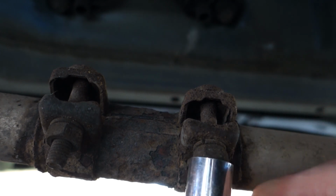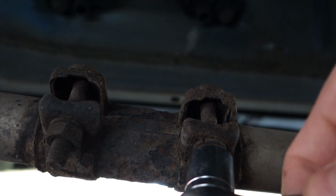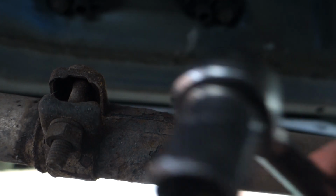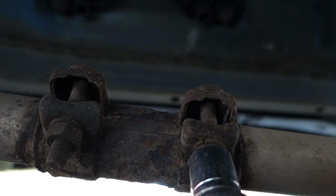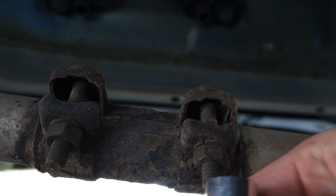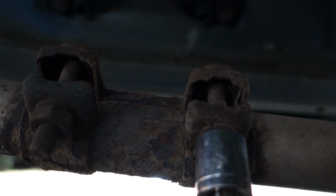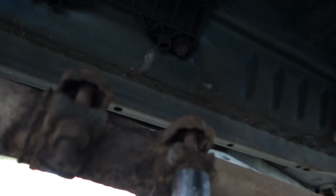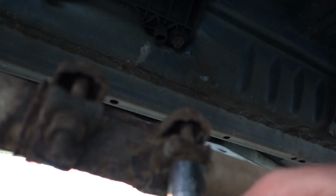And just give it a little. Straight away I've got a problem as the socket is not deep enough for this thread, so it's catching the ratchet. One way you can do it is put it half on the ratchet, but then you risk it slipping, or use a deeper socket and/or a spanner. It's not focusing, but the ratchet's only halfway into the socket. That's one way of avoiding having to go out and buy a new socket.